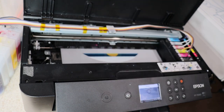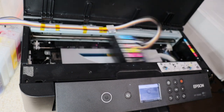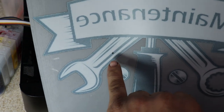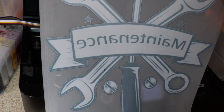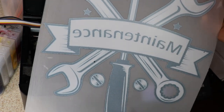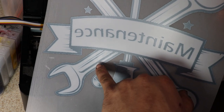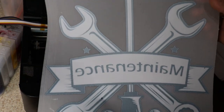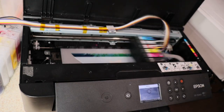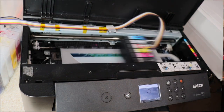So there you have it guys. I'm doing a test print because one thing that happened on the previous print — hopefully you guys can see it — there was still a little bit of goof off and you can see the dot where the goof off actually landed on the page. You can see now I'm printing the white, so white is coming out — it's pretty good. But you can see where the goof off was still left on the ink channel, and when the drop hit the print it really messed it up. This has no powder, it's just the print. So yeah, it worked. We saved another printer and this person is going to be really happy.